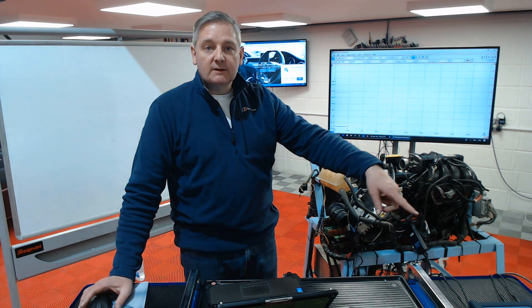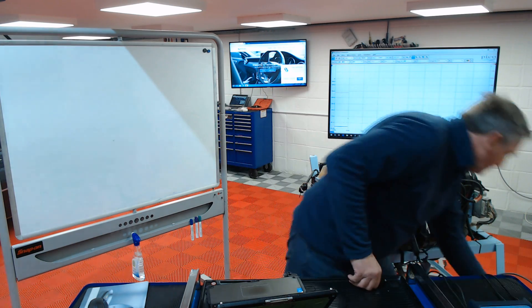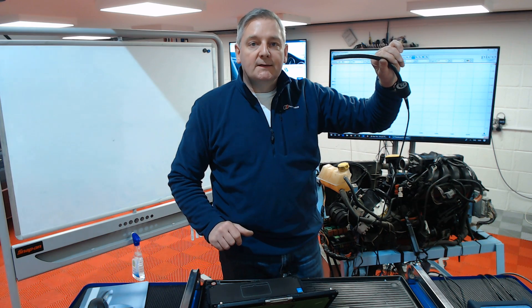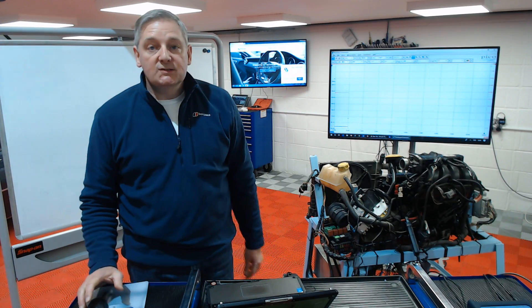Hello, it's James from Technical Topics. This afternoon we're doing a quick video on cranking compression test using Pico. We've got PicoScope here. We've got an overhead valve engine and we're using two main input types. We have a current clamp around the starter motor and we are using a Ditex pressure transducer in the exhaust pipe, and the idea is to show a quick video of how easy it can be to get engine condition tests.